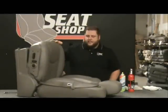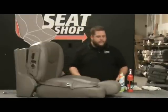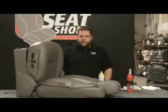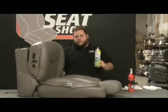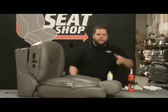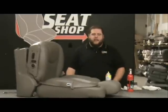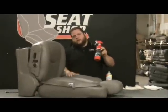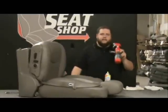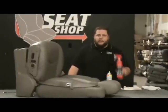Once you go ahead and recover your bottom with a new leather seat cover, it's always a good idea to give your old existing leather a good tough scrub — get all that dirt and grease and grime off it. A little trick that we use, and definitely don't want to use it over and over, but for a one-time good scrub: Scrubbing Bubbles Bathroom Cleaner. It seems to be one of our clean-alls around the shop. Get a good coat on there, use a good brush, scrub it, and wipe it off real quick — don't let it sit, there's some pretty hard stuff in here. But it'll really get all the grease and grime out of your old leather. Once you do that, you want to come back over it immediately with some Mother's leather conditioner and cleaner. This stuff will seal anything off so you're not going to hurt the leather with the Scrubbing Bubbles. You definitely want to come back over to condition it — just a one-time clean with Scrubbing Bubbles. It's not meant to clean leather over and over, but a one-time scrub is great. Come back over it with a good conditioner and you're going to love it.